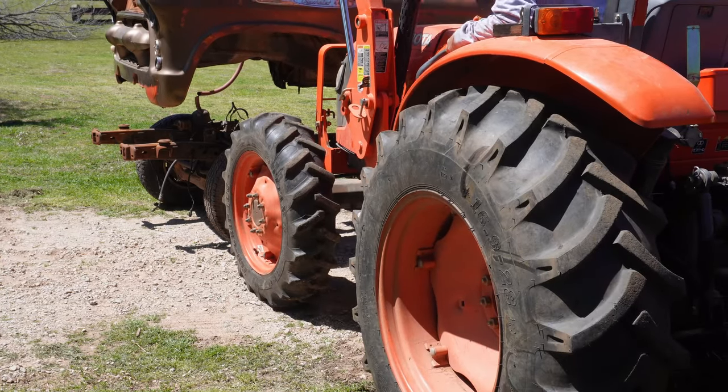Well, folks, it's setting down on there. I'm happy to see it on there. For those of you who watched the first video, remember I said that some trucks, you need to see how they sit in terms of where that front wheel is? Well, apparently this is one of those trucks. I don't have one of these that's all together, so I didn't know how the factory one was going to set up in there. But it looks like that front wheel needs to go about 2 inches back, maybe 1.5 inches. Have to look at it, probably 2 inches.